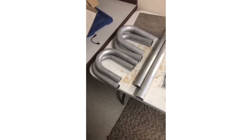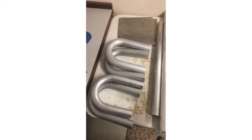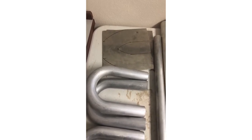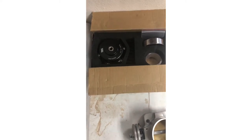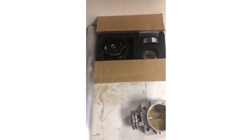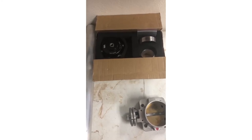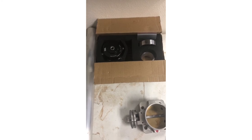I'll start on the intake side. These are the materials that came in: I have four intake tubes — two are inch-and-a-half and two are one-and-three-quarters — that will bring the intake up over the top of the engine. I picked up some aluminum and have a plenum design that leaves a spot in the middle for the dipstick and oil fill tube. I also have a pop-off valve. I'm not running a traditional wastegate; I'm running a manual wastegate, so I'll leave it in the no-boost position and add boost with a lever next to the throttle as required, keeping an eye on manifold pressure. Just in case, I'm putting this pop-off valve on the intake side so it will pop off if manifold pressure gets too high.